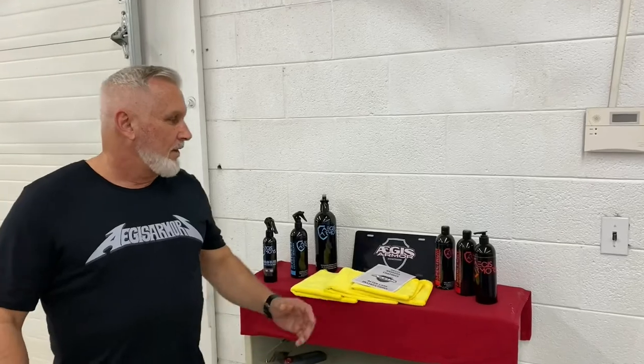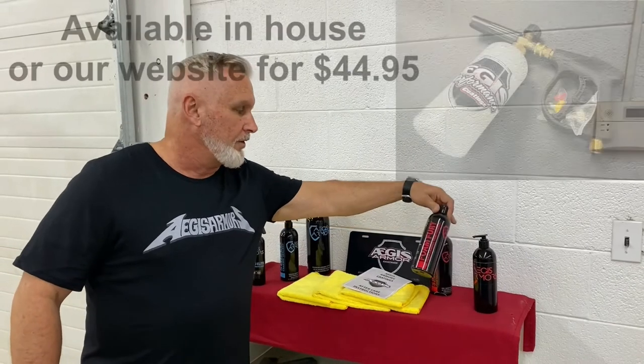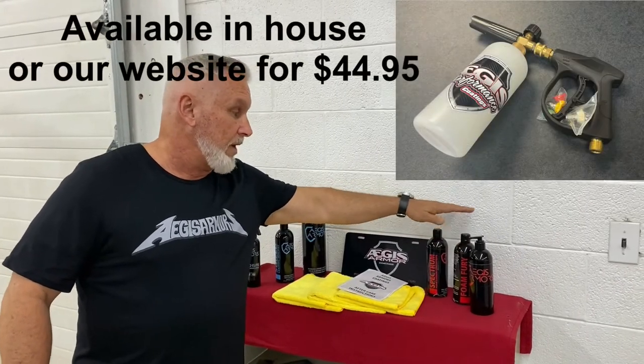Okay, what we talk about with every video on every vehicle is how to wash them and maintain them. Every couple weeks, you'll take a pressure washer, you'll rinse the vehicle off. You use our Aegis Armor Foam Fury or Spectrum, which is ceramic-based soap. You'll apply these with a foam cannon, let it sit for about a minute, rinse it off, and then take a leaf blower and dry the vehicle.